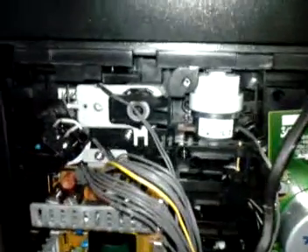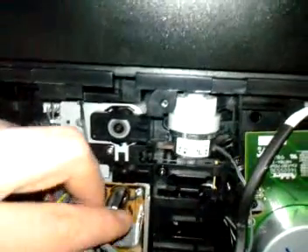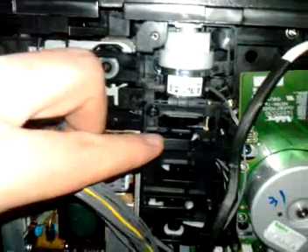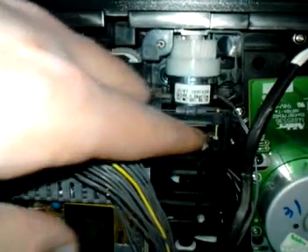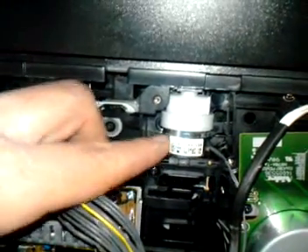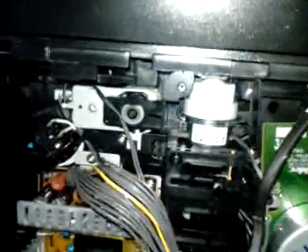In my case, I noticed when it was turning on, this right here — this is the motor. I'm not sure exactly what it turns inside; it may actually turn all the rollers. From this standpoint, how it interfaces with the sensor down here is: as you can see, there's a little cross that slides in and out of the sensor. If this motor isn't properly set, you see how it's a little loose there — it's moving, it has up and down, left and right. If it does that, the sensor is going to see that jitter and it's going to shut it down and throw that error.